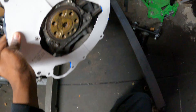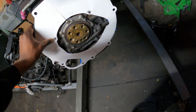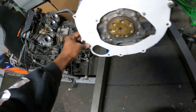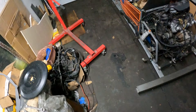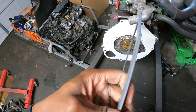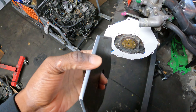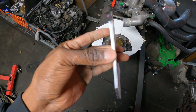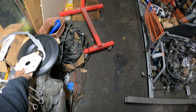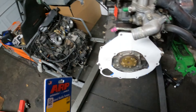I took my vinyl cutter and made a little template - it's no longer a rectangle, it's a hex shape, better for bell housing design. This is an accurate template of where all the bolt holes should be. Also made the same thing for the engine side. This white piece of paper is the little guide plate and gasket plate. All the bolt holes line up nicely. We might do it out of a thicker piece of metal so it won't warp when welding. Raymond recommended 3/8 instead of 3/16 thick - after it's welded it may deform, then we sand it down.